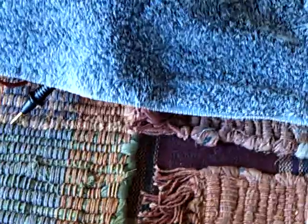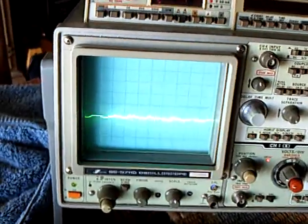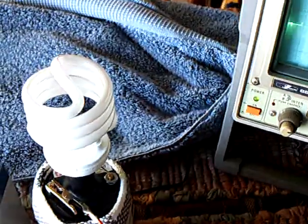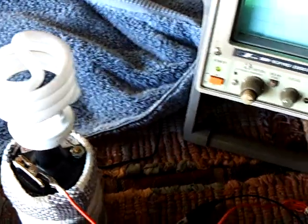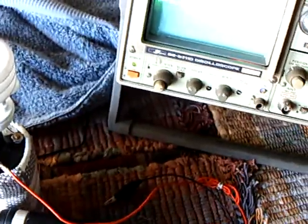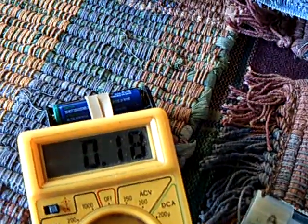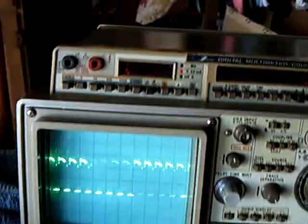What I'm going to do now is zap this with 12 volts. If you keep this spinning — first I'll disconnect this. It's disconnected, and I still have some sort of a wave pattern going on there. Let me connect this up here. There's the cap loading up — 42 volts. This is on a 12 volt battery here, and I've upped my amp draw to about 180 milliamps. Here's the H pattern — it's a little harder to adjust with this.